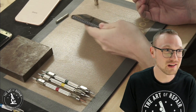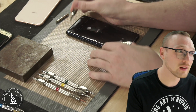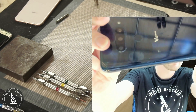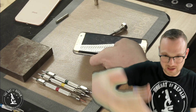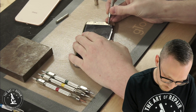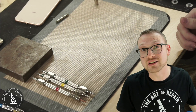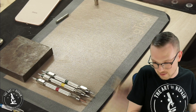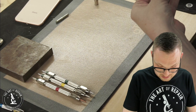Let's try it on some phones. Let's try it on this LG V40. I'm just turning it just a little bit, and you can see I've already got a little crack down there. If you want to get more, you just rock it back and forth — that's it, very little bit of pressure. Let's move over to the Samsung. I know some of you guys have those really big clamp-like tools — it's ridiculous. We're going to go up to the top here and just... how about that! And the best part about this tool is it's not going to get dull. When you use stainless steel tools, the tips end up getting smushed and bent and you have to buy a new one — it's a consumable tool. Tungsten carbide is definitely not a consumable tool. This is going to last you a super long time.